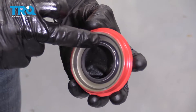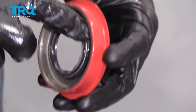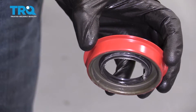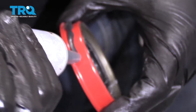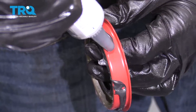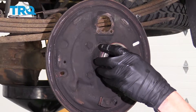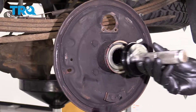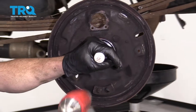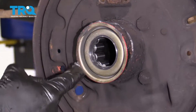If you look along this area of the seal, you're gonna notice you have a little spring. Just take a little bit of Vaseline and put a light coating on that spring — that's gonna help keep it in when we start bonking on this seal. Now we're gonna take some RTV or gasket maker and go along that outer edge where it's gonna connect to the differential tube itself, going along that whole edge. Let's get ready for an install. Now that we have the seal all set and ready, go ahead and line it up, then bonk it in there so it's nice and flush. I heard the audible difference there — let's clean up the mess that comes around it.